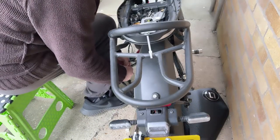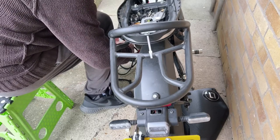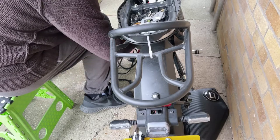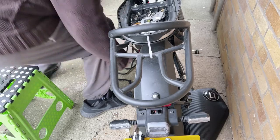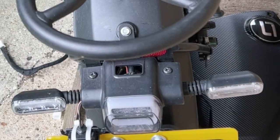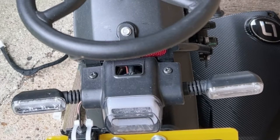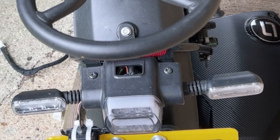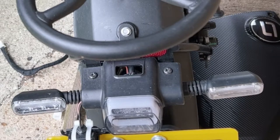Here you see me swapping over the towing electrics, which work perfectly, onto the normal plug, which is incorrectly wired. Just remembering, the knocking noise that you hear is the solenoid, when the brake light is activated. As you can see here, when the brake light is activated, the indicators on the back stop working. And when the brake light's activated, it doesn't illuminate the brake light, and also the tail light stops working.